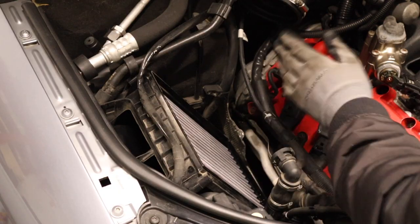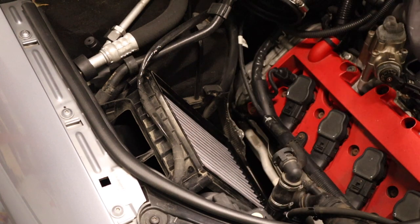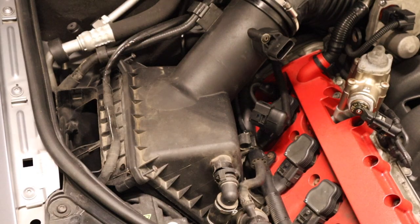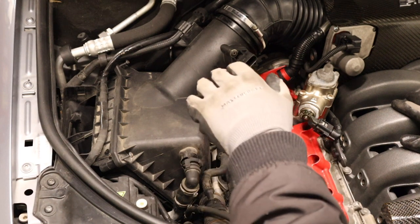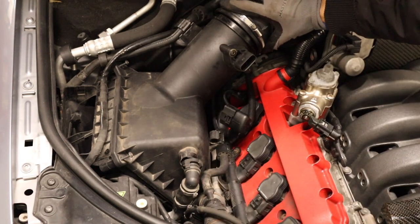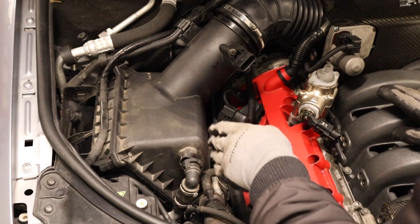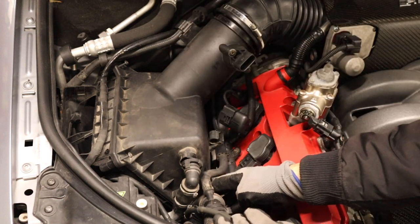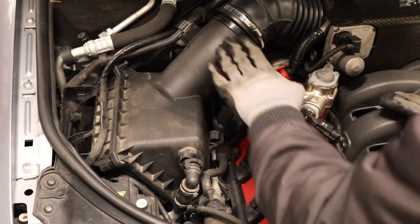Re-enter the flimsy coolant line. For those of you who have watched the carbon clean videos, you will remember this — this is that flimsy coolant line which curls around the back of the firewall. Be very careful when you go to reinstall the box not to break this. Getting this air box in without damaging the coolant line, minding the vacuum line, the lines at the top, and having the ability to hold the flex tube out of the way as you slide those bottom tabs in takes some care. Those two bottom tabs have to clear things on the backside of the air box as well before they'll go in. This coolant pipe you might have to push it forward just a tad in order to slide it down. This air box does take great care to get back in without damaging things in the area.